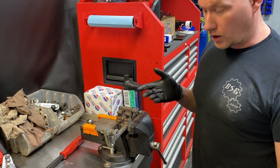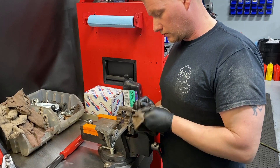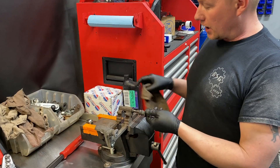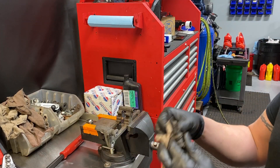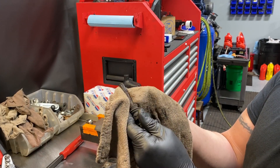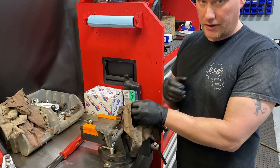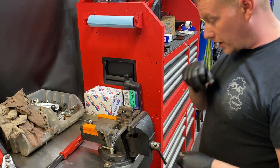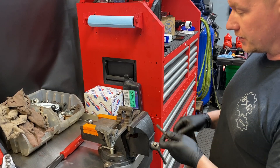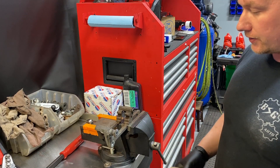Spinning the pin as a reamer generally cleans the rust and dirt without ruining the actual bore. Once it plunges freely, clean the pin itself with a wire brush at the bench grinder. Then use silicone brake grease on the pins — once fully lubricated they'll slide right in and out nicely. Do the same for the other pin even if it wasn't seized, so it doesn't seize in the future. Clean it off and put a healthy dose of grease on it, then reinsert it so it locks on the boot.